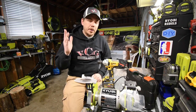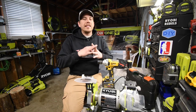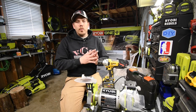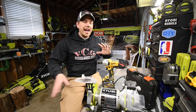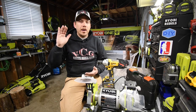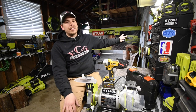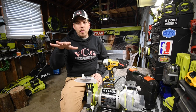As you can see, that's a simple solution to clean up your prop if it's too sharp from hitting the bottom of the ocean or lake — if it's not completely torn up, there's no issue. I learned my lesson: from now on I'm only going to use a brand new prop about a month into the season, because it just gets torn up from the sediment on the side of the flowing river. The water wasn't deep enough early in the year, but it was deeper about a week later. Now at the beginning of the season I use an old prop and put a new one on as soon as the water rises.